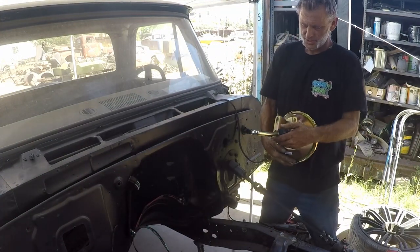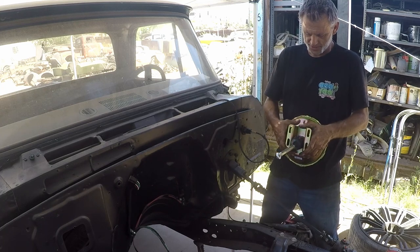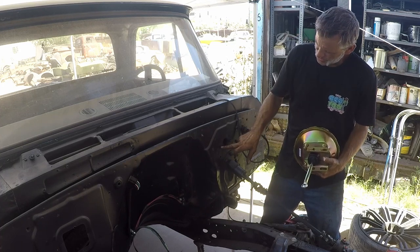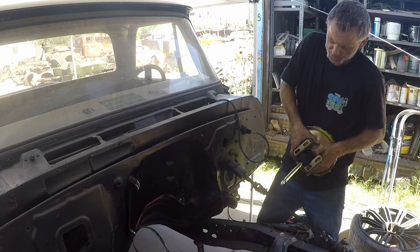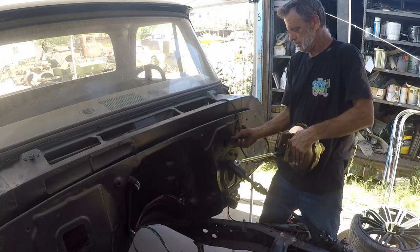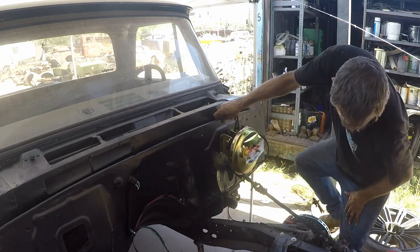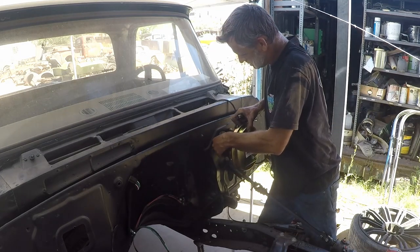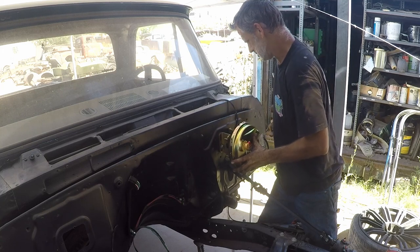Alright guys, it's your typical booster, push rod, pivot point for the pedal, brackets, all that stuff. I've had to move these brackets around a little bit to where I could get at least to this hole and exit this hole. So probably what I'll do is once I get it mounted, I'll mark the firewall and punch a couple more holes, because I really would rather not just depend on two holes. Starts of that. We'll go ahead and cinch that guy down. So let's go ahead and stick the bolt in the other side, and then we'll tighten one side up. Alright. Yeah, looks like something like that.